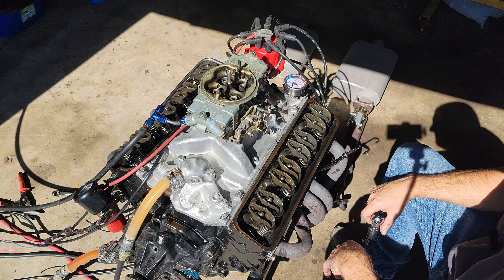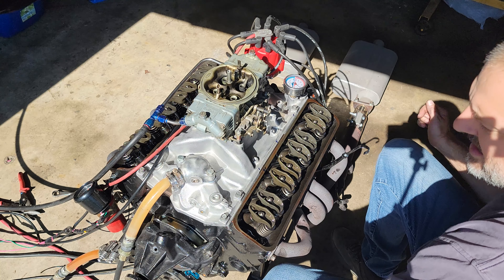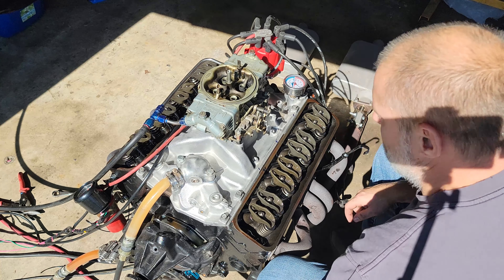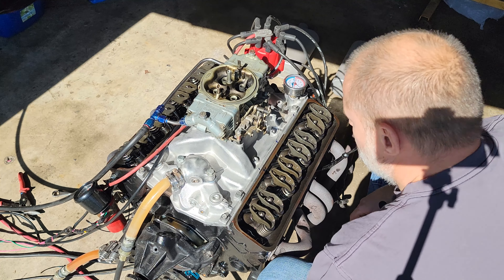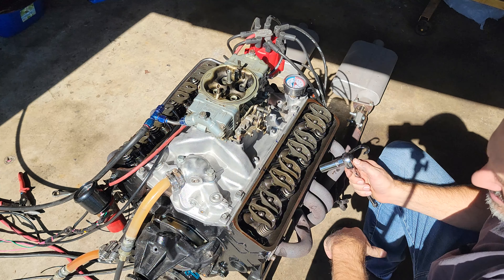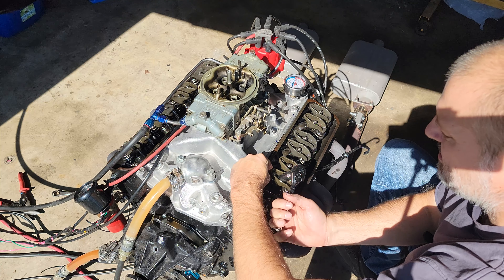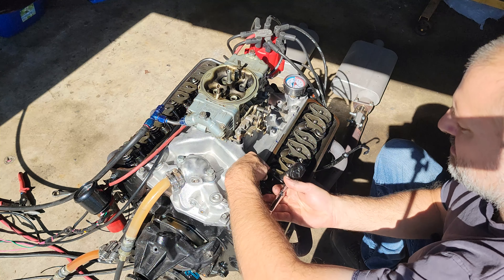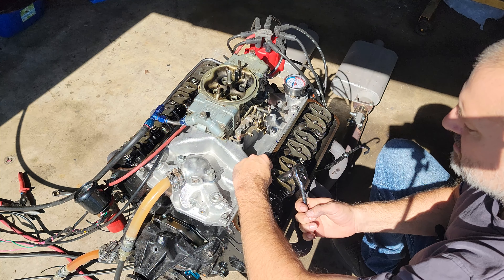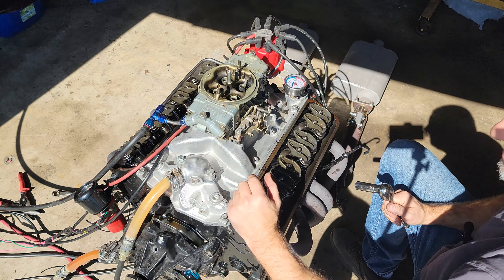I've got three lifters that are not rotating on this engine. Let's go ahead and check the preload and see if the cam has worn at all. With the exhaust open, we can check the preload here — it still has some preload on it. I put the preload on these lifters a little over half turn. Let's do a quarter turn and check. Still got preload, we'll do another quarter turn — still got some. Do an eighth — I must have went a little over. All right, no preload.